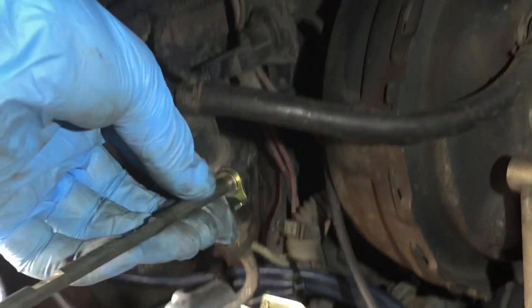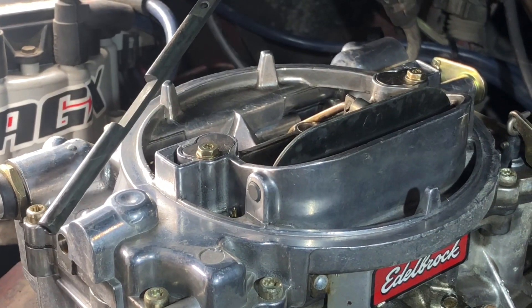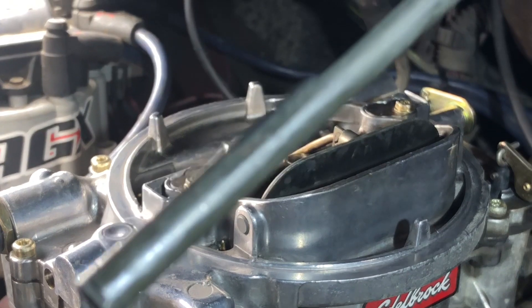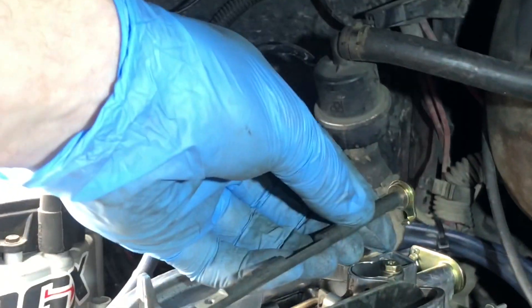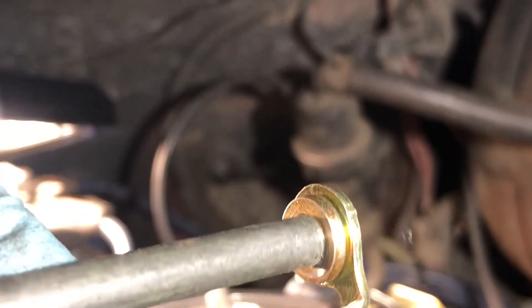So with this shaft all the way through here, there's a supplied washer, but I can't get the washer on and still have room to slide things through. You see this indent here — the washer should slide just a bit past that indent that way you don't have a lot of back and forth issues. The reason I need to do something is that the mating connection isn't the best, so what I'm going to do — because I don't have a thinner washer — is very carefully smooth down the back side so I have more of this side protruding in.